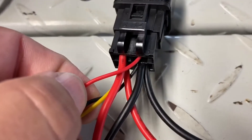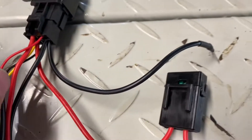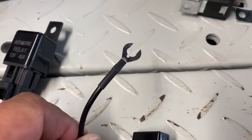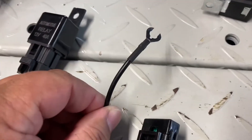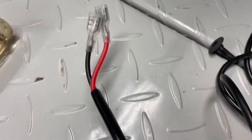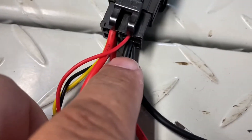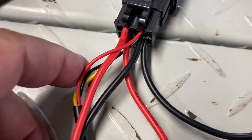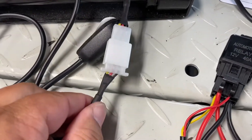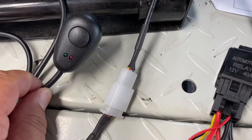The bottom right black wires — there are three black wires all going into one connection. In this example, it's going to be your ground wire, which you can connect to any good ground. It does not necessarily have to be your negative battery terminal — any good ground. The wiring that goes to your LED light bar is also grounded into that same one. And this little black wire is part of the switch. You're not using this switch — you're just going to cut off that wiring and tap right into it and throw the switch away.